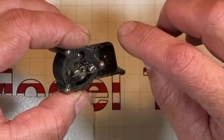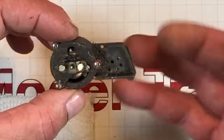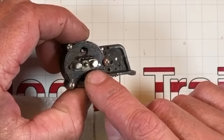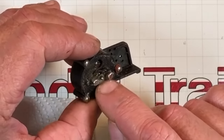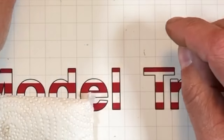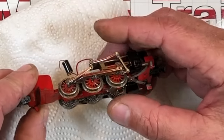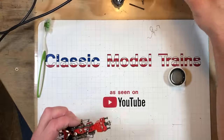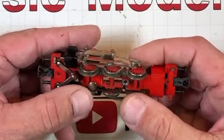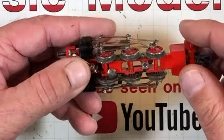Clean all these little parts up - Q-tips and some odorless mineral spirits to wipe around it. Get the brush cover off, brushes are stashed in there. Clean that armature, lube these bearings. We're gonna let this sit. Oh we've already got a little movement - whoa, this is already getting better! The Inox started to break it loose and I've been gently rocking it back and forth and spraying more in there.